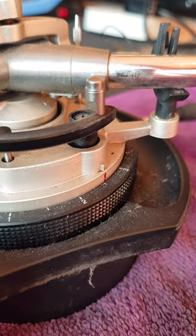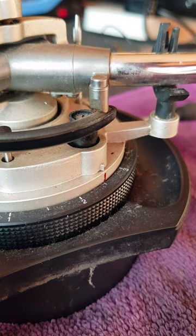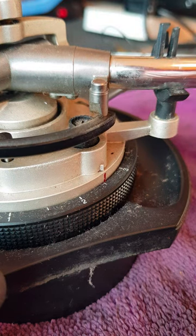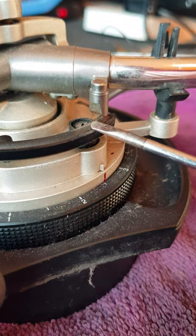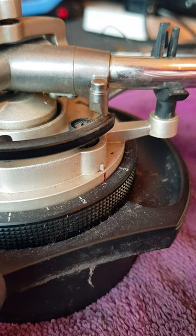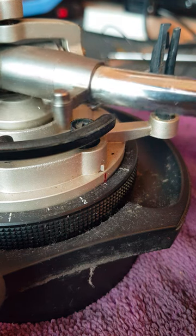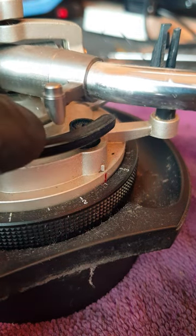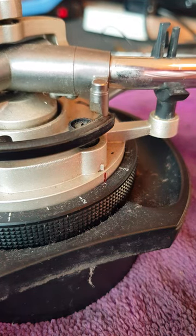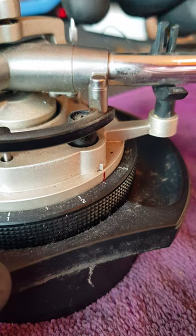Once that clears, that should be just about the right place for it. Lower it down and you'll see that when this bit goes down there should be a gap underneath, so that when your tonearm is on towards your record with your needle in the groove, it's not going to catch and slow the arm down, stop it, or cause it to drag. So there should be a bit of clearance there — and that's how you adjust it.